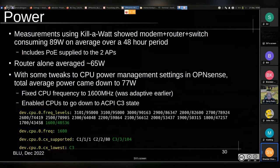So the kind of changes I made was to lower the CPU frequency down to 1600 megahertz. This was adaptive earlier. And so I don't think this helped a whole lot, maybe saved a small amount, but the bigger one was to enable the CPUs to go down to a ACPI C3 state, which is a much lower power state, when the CPU cores are idle. By default,